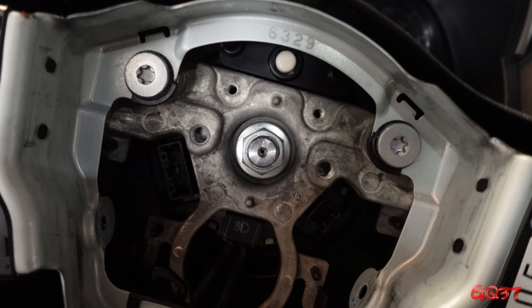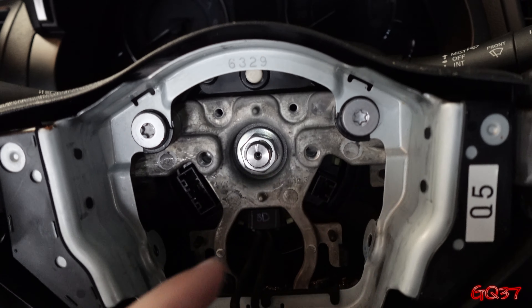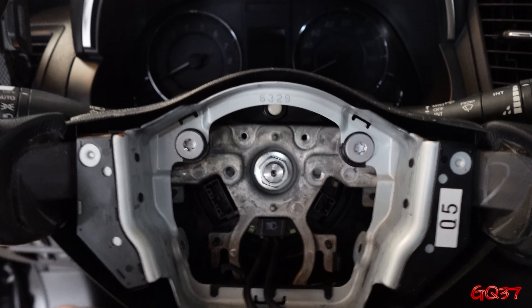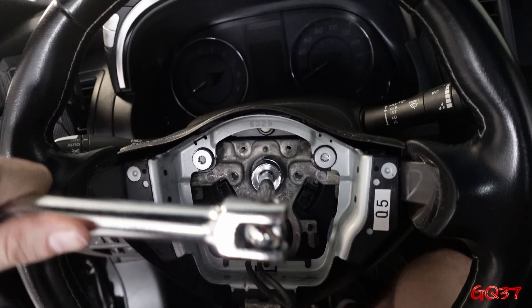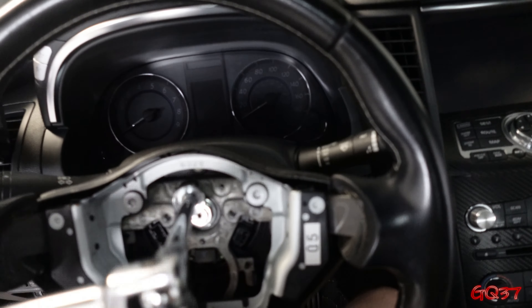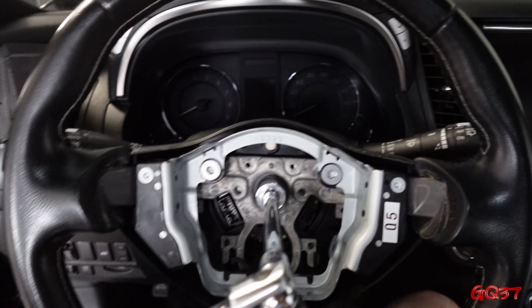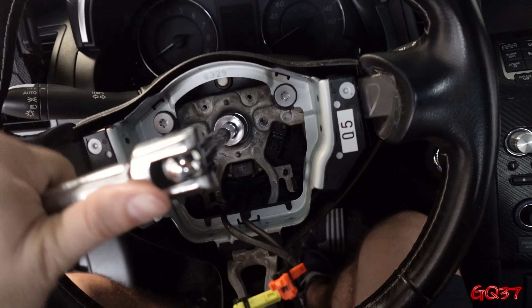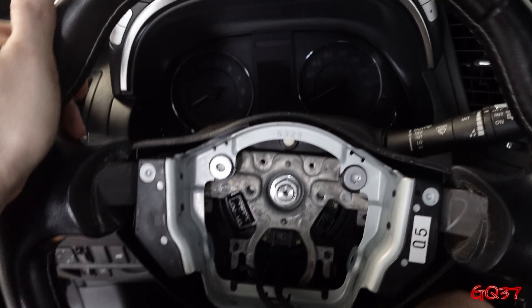You've got this 12 o'clock notch, which is very important — it needs to be in the 12 o'clock position. Once you take this nut off, there's going to be another line behind it that needs to line up perfectly when you put the new steering wheel back on. That's how you know your steering wheel is straight. If it's off left or right, your steering wheel is going to be off when you're driving. After you get the nut loose, do not take it all the way off because you're going to have to shake the steering wheel pretty violently back and forth to loosen it up, and you may hit yourself in the face if that nut's not on. Leave it on a little bit just to protect yourself, then remove it once it's loose.